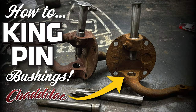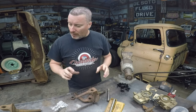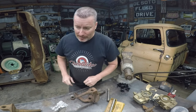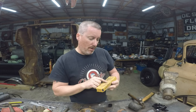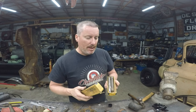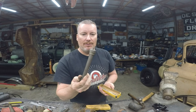Let's do some kingpin bushings. I've got a project I'm about to start that I'm going to show you guys, but before I can, I need to get these bushings knocked out so that I can put another set of bushings in here for my new kingpins. Early Ford kingpins are .814. This one says it's for all A, B, and V8 Ford Mercury cars and V8 half-ton light delivery trucks. That's the size you need if you're looking for one on eBay — you can find these from time to time. This kit is helpful because it makes it a lot easier putting the bushings in.